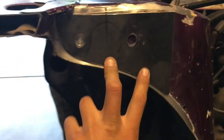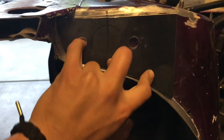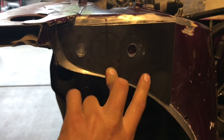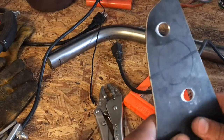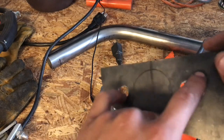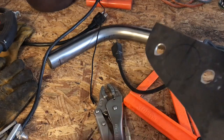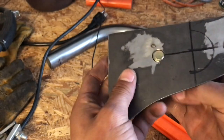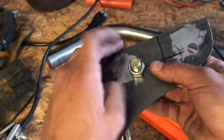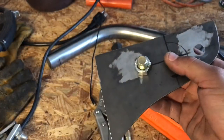In my case, it's right here. I'm going to have to drill the strut tower out so that the nuts that are going to be welded on the back of this plate will fit through the strut tower. So when you have your placement of your holes, you pretty much drill them out. I have half inch bolts, so I drilled my holes out to half inch. What you do to make it easier on yourself is grab the bolt, shove it through, and then get the nut that's going to be welded on the side and pretty much just screw it on.